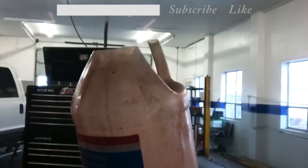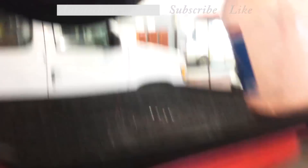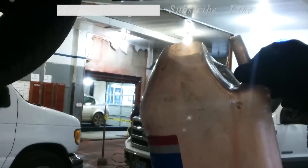When I pulled the drain plug, the fluid was filled up. I used a washer fluid jug to give me an idea how much fluid to put back in. Using a 15/16 socket and extension — lefty loosey, righty tighty — I took the drain plug out. We have a nice fluid capture device at the shop, but you can use any container. It got up to the tippy top and was starting to overflow, so I pulled it out of the way. That tells me at least four quarts of fluid came out. We took the drain plug out and we're letting it drain.